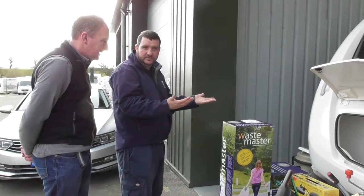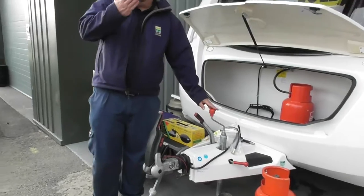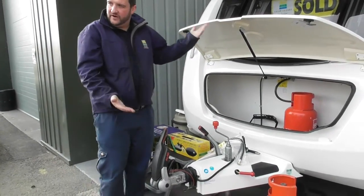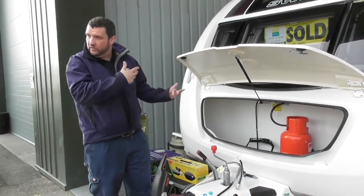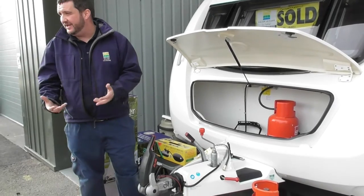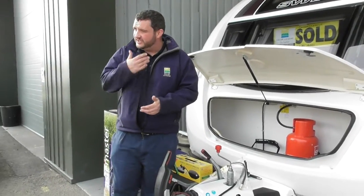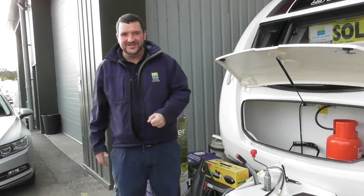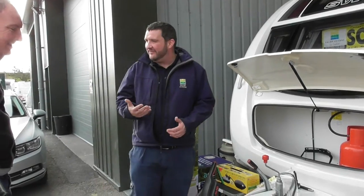So left to right first — put something underneath your wheels. Then once you've got it on, handbrake on, take it off the vehicle. It's the jockey wheel on the front which you use to raise and lower the nose, so you can get it level front to back. Left to right under the wheels, front to back off the jockey wheel. Then once you've got it level, front to back and left to right, you can put all four legs down. The main misconception with caravans is a lot of people think the legs are there to raise the caravan up — they're not, they're there for stability. And wait until your fried egg in the frying pan and all your eggs are sliding down to one side. After a week of standing sideways you will notice it on your body, so it's more for your comfort.